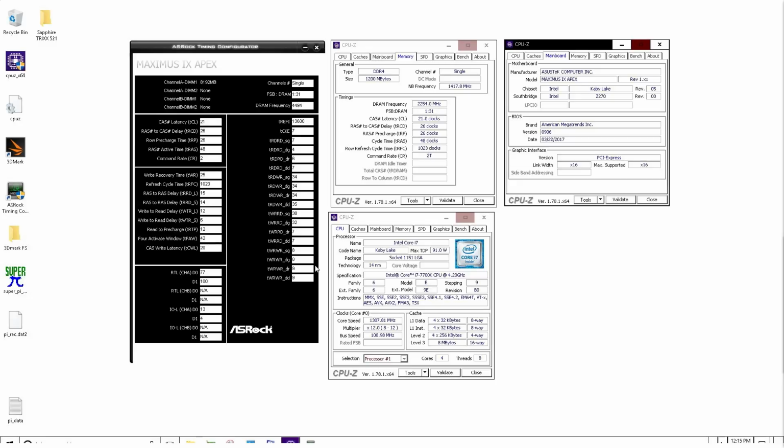we can run 5 gigahertz memory clock. It's because 5 gigahertz memory clock sucks. You can't run it. Your timings end up so loose that any actual work being done in the RAM takes a month to finish, and so the performance is awful. So nobody actually runs really, really high memory clock if they want to do SuperPi benchmarking or something.